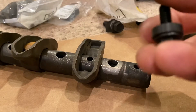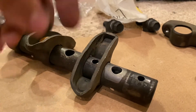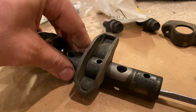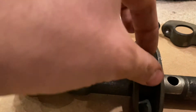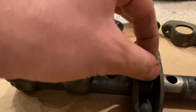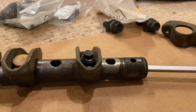As I said before, take your extended washer, bolt, and nut and have them ready. Remove the outer retainer and have your rocker in place where the hole is accessible. You want to be able to see down into the hole. Basically, I set the nut on the end of the screwdriver and slid it in until I could see the hole of the nut, then thread the bolt in while putting upward pressure on it with the screwdriver. Then you can turn the screwdriver sideways to lock the nut from spinning.